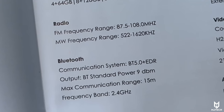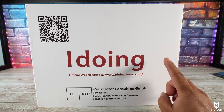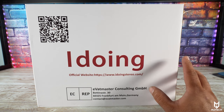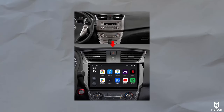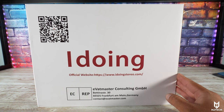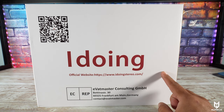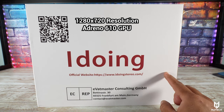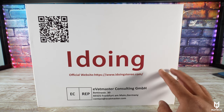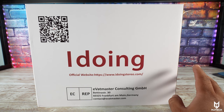It also comes equipped with Bluetooth 5.0, a 10.2 inch display, and it is a double din unit but thin, so it doesn't stick out to the back. You can upgrade the memory up to 256. The display is a QLED panel with 1280 by 720 resolution. The GPU is the Adreno 610 and it does have four times 45 watt maximum — so that's approximately 180 watts.